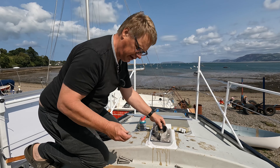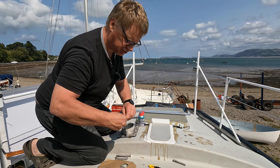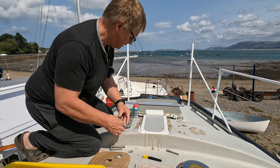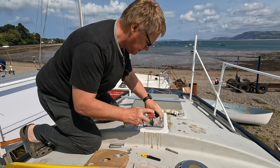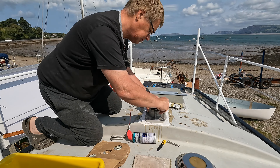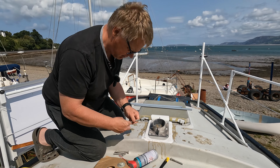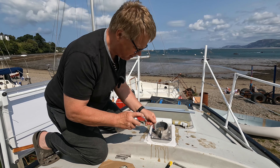This is going on there. I've got holes in the butyl sheet for the bolts, and I've got this bit of butyl strip. Roll it into a little sausage and wrap it around the bolt. Then spray with this lithium grease which is supposed to stop galvanic corrosion. Push that in and then rinse and repeat — Jane said she doesn't think I should rinse it, and I said I'm rinsing it in grease.